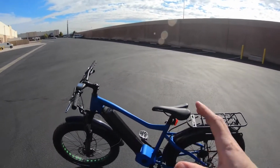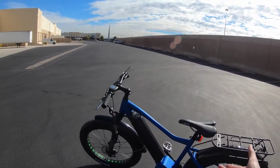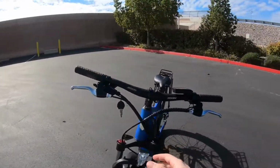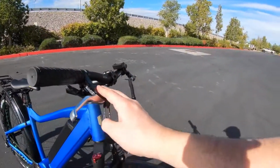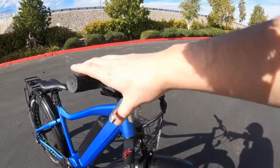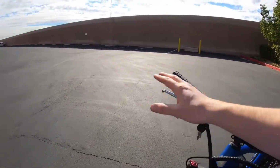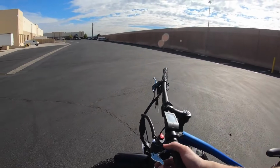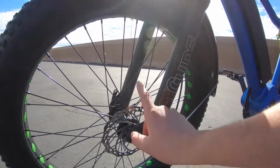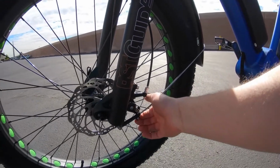So this one has a really nice electrical system. It's pretty boss. The mechanical system by default does have upgrades available. That's an indicator of what you're getting, because you do have some fairly basic Wuxing branded brake levers for mechanical disc brakes. EUNORAU does provide an upgrade option. You can get hydraulic disc brakes on this bike, which personally I would do. You have 160 millimeter rotors on the front as well as on the back for the mechanical disc brakes.